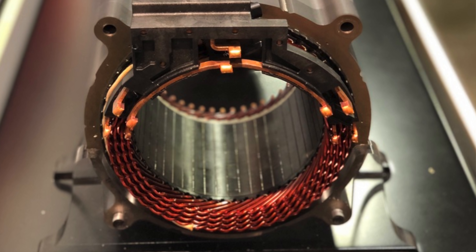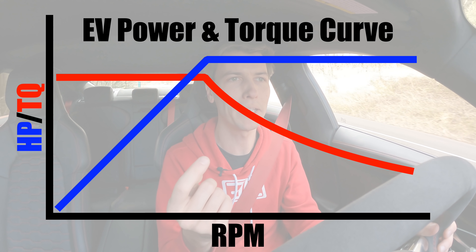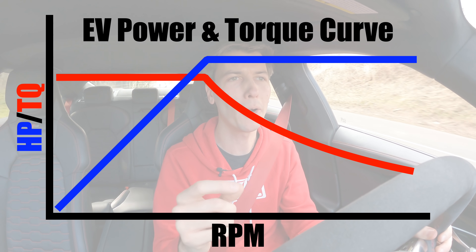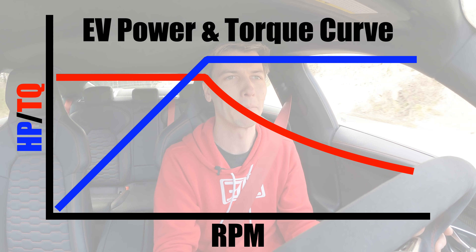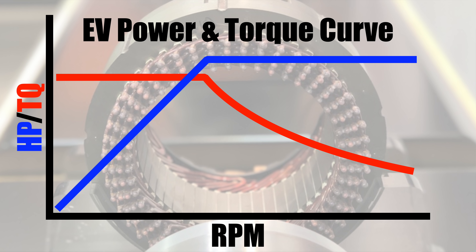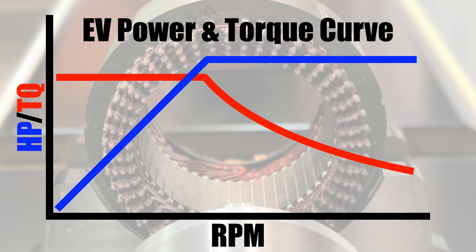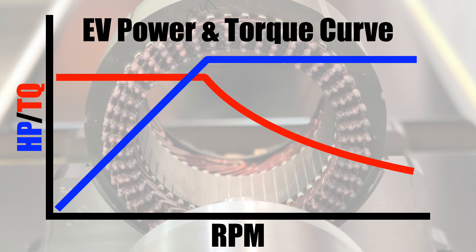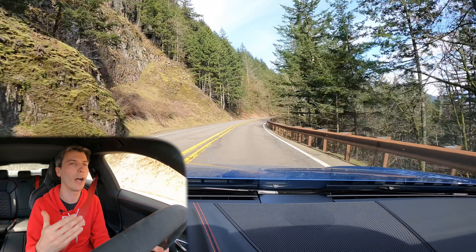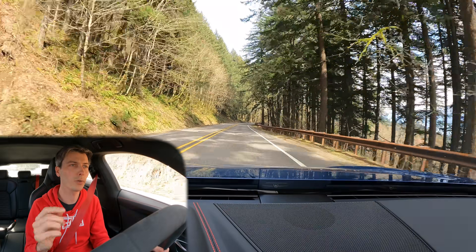The reason electric cars don't use multi-speed transmissions isn't purely about acceleration — it's because electric motors are very different from combustion engines. They have an extremely wide RPM range and make efficient power and good torque across that entire range. A combustion engine can't operate below about 700 RPM, doesn't rev all that high, and if it does rev high it has a narrow power band. Electric motors have a perfect torque curve: peak torque maintained until peak power is reached, then peak power maintained — something you can't achieve with a combustion engine. Because they rev so high, you can reach high speeds even with a single gear ratio.